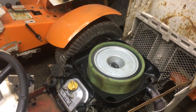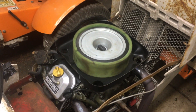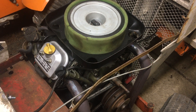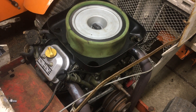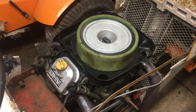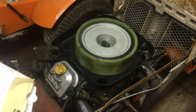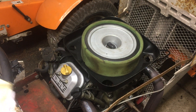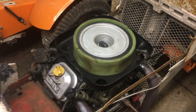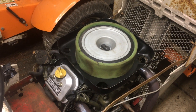In my comment on Sprocket's video I said the engine in this thing is pretty much bulletproof, and the reason for that is I have the throttle limited to only half throttle. Half throttle on this thing without the governor — I don't actually have a tach hooked up to it, but based on what it sounds like, I would guess it revs out to about 4,000 to 4,200 RPM.